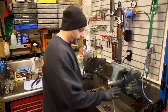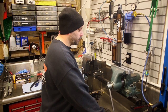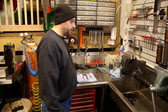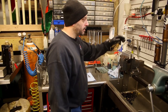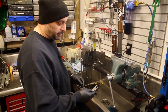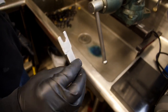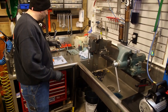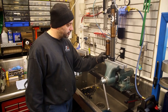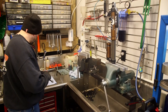We're over here where I rebuild the shocks and got all the tools. Got some things laid out today that you would use to disassemble the shock. Removing this cap takes a special tool - I made this tool on my plasma table but Fox sells a tool very similar. They also have a special tool to remove the compression adjuster from the body cap.